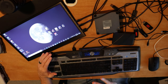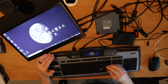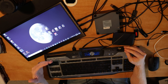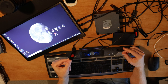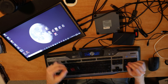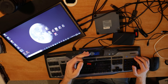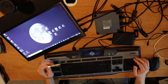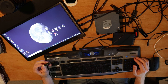To recap, to get this accomplished, personally, I highly recommend Acronis True Image. It allows you to create a bootable flash drive, at which point you can do a full disk image of your hard drive, take that image and restore it to another hard drive. That's what we did in this case.